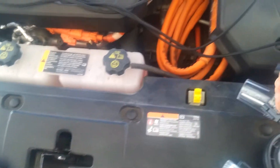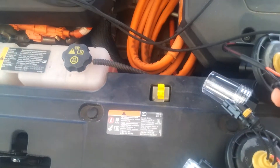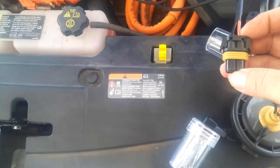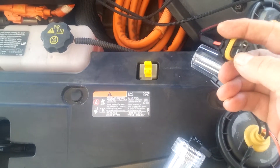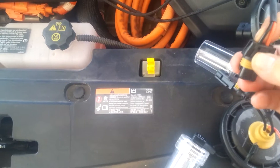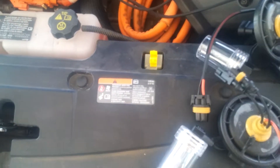The answer to the first dilemma that a bunch of people couldn't figure out is: you've got to take these pins out. You'd have to drill a huge hole if you want to pass the whole connector through, and then your grommet's not going to do you any good. So you have to disassemble this. I've marked the orientation of the positive and negative. This little clip piece pops off — you need a tool to go on the inside of these tabs and release the spring-loaded tab. These have a nice silicone grommet on each wire down inside. You have to pull it apart, put your wires through the correct way, and then put the plug back together.